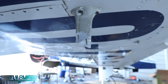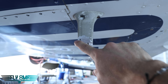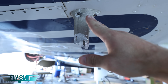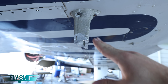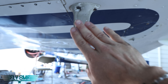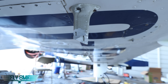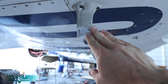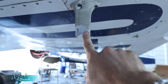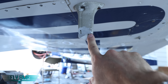Hopefully that gives you a good idea of what your pitot static system is made of. Remember the different failure types: if you plug your pitot inlet but the static remains clear, your airspeed acts like an altimeter — that has led to many accidents as people climb, see increasing airspeed, pitch up more, and stall. If you plug both, everything freezes at whatever it was — airspeed, VSI, and altimeter all freeze; VSI will initially go to zero since there's a calibrated leak in that instrument. If you plug just the static port but leave pitot alone, your airspeed indicator will work kind of normally but won't be super accurate, and your altimeter and VSI will be frozen.